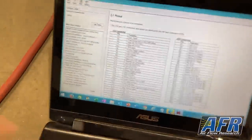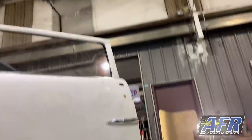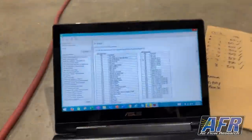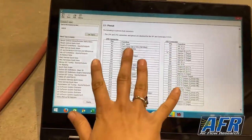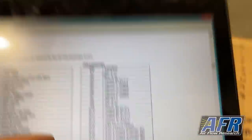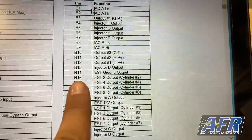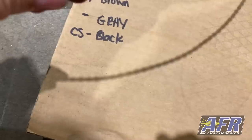So when you come into the Holley software there's the help section where it shows all the wiring pinouts and everything. Back to the tech — here is the pinout for your J1A, J1B connectors. Those are what you would call fixed outputs, fixed inputs — already defined. On the J1B connector, B14 to B18 are your even cylinders: 2, 4, 6, and 8. And down here for your odd cylinders 1, 3, 5, and 7 it shows B21 to B24. On these wires, which I was sorting out earlier, they are labeled — these are the ones that come out of the 600 box, and this is coil C.